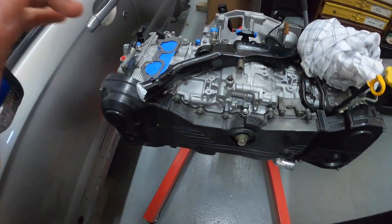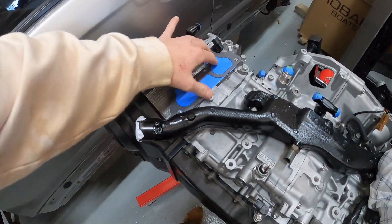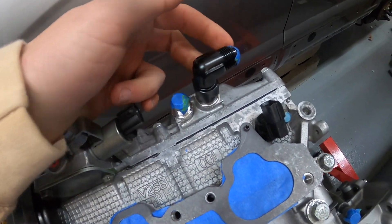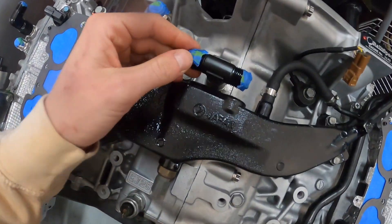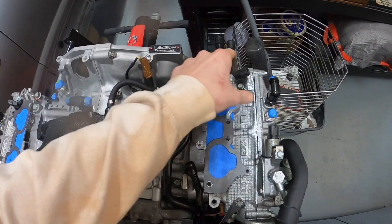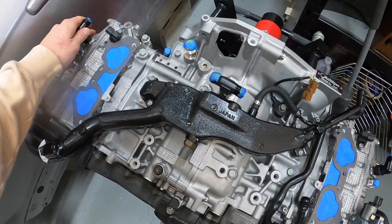That's a real quick update on the issues - you can see how these little things add up and take a lot longer than you'd think. On the engine, I painted the coolant crossover black which I'm really happy with. I've been test fitting some TGVs on here and I have 90-degree AN fittings on my valve covers. Both sides go to the middle of the engine where this T fitting is, which I installed, but the way the TGVs sit it creates a sharp turn for this line.